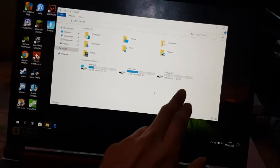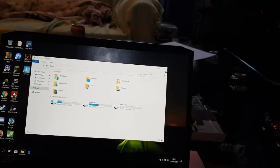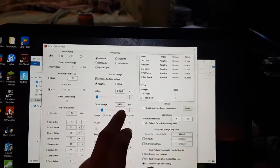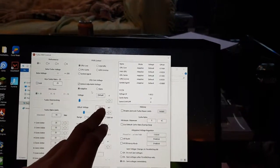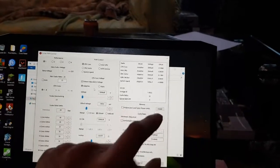Okay. Hard drive space, we've got plenty. RAM, CPU-wise, I'll show you now. FIVR, so we can go up to 4.5 gigahertz. And my new undervolt is 148. If you watch my undervolting video, I was a bit lower than that, but that's my new undervolt. 148, that's the max I can go at the moment, because 150 gives me a crash after a while, usually when idle. You know when you crash because it makes a weird noise. It goes do-do-do-do-do-do-do and you can't do anything.